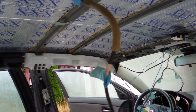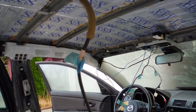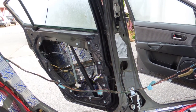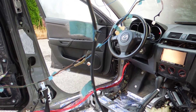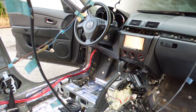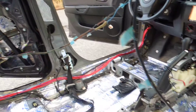So from here I'm probably going to throw the headliner back up and then it's time to do each of the doors. You can see I did that one door over there. Plus we're going to do some Dynamatting on the skin that goes around the door to make sure that doesn't rattle. And I have to build some spacers today and mount some tweeters, so I've got my day cut out for me.